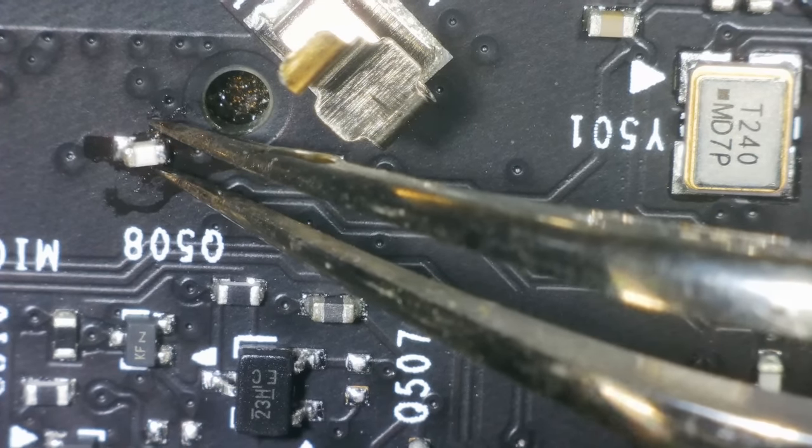I can't remember what it was when I put these in. 2.847, 2.846, it's dropping. It's definitely using battery power when nothing's being pressed. What is going on? I don't know whether to inject some voltage in there. While I've got the board out, I can see the components. Let's try that, because I'm not getting anywhere with anything else. I've got 3 volts going in, it's not drawing any amps.